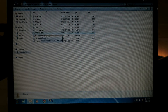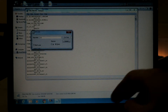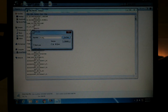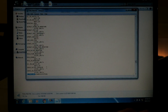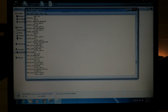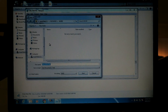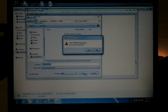I don't have any modified trace files, so I'm going to do it in the basic form, which is manipulating the FSW_PSW file. We'll go to drive C, NCS Expert, into the work directory, and look for that trace file. We're working with the FSW_PSW trace file. For the actual backlighting command we're going to search — Control F — for M_TAG_SKA. That should pull up what we're looking for: skalenbeleuchtung. This should currently say 'nicht aktiv' — not active.